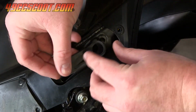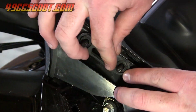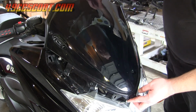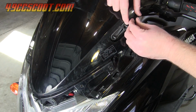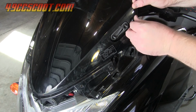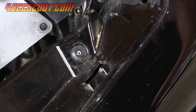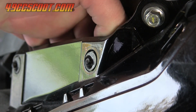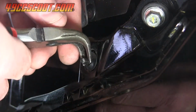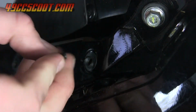Next, I slid the rubber dampers for the mirrors back on as shown. Then the tinted panel was reinstalled and secured with the 7 screws around its edges. These screws are plastic, so you have to be very careful not to over-tighten them or they will break. I snapped one after deciding to give it just a little more torque. Luckily, I could reach in and unscrew it from the other side of the panel and then grab it from the outside and finish removing it. The plastic screws for the clear shield were the same, so I didn't need to find a replacement.